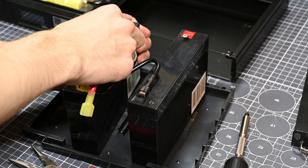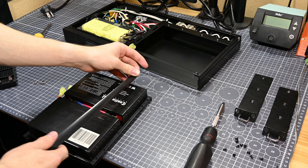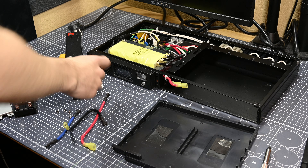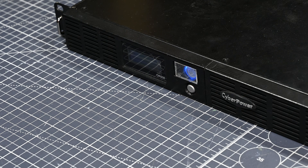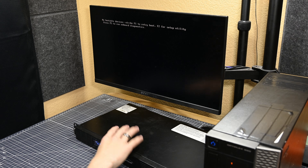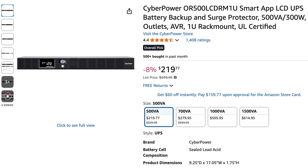My cells were in good shape with similar voltages, so I wired them in series exactly like the old cells and put them back on the tray, securing them with electrical tape. One note about the exact replacement cells I used: their terminals were a bit smaller than on the old cells, so I crushed the spade connectors to make sure they still made good contact — but you may want to buy different cells if working on a similar unit. After installing the new pack, I powered the unit on and was very pleased to see it recognized the cells as charged, and when I unplugged it with a desktop PC as the load, it switched over to battery and powered the computer perfectly. UPS 1 of 2 fixed for only $30 in batteries — a major win, considering a new unit is $220 on Amazon and official replacement batteries cost $80.